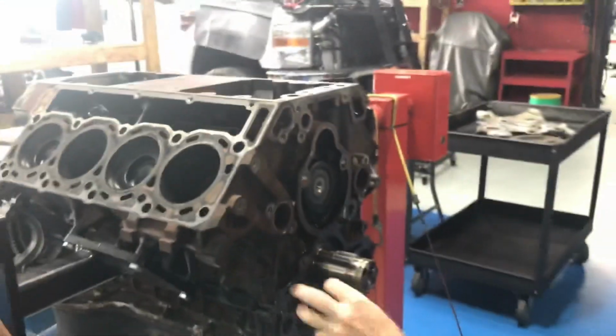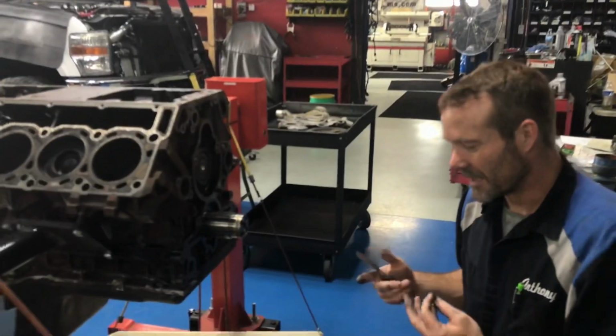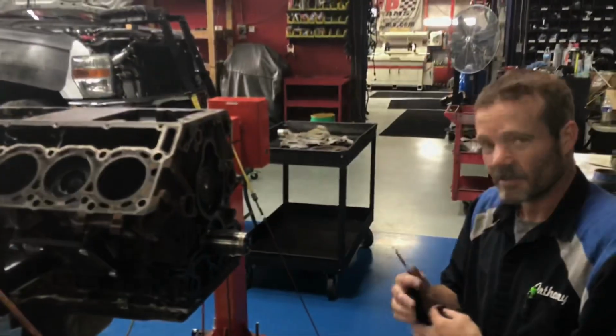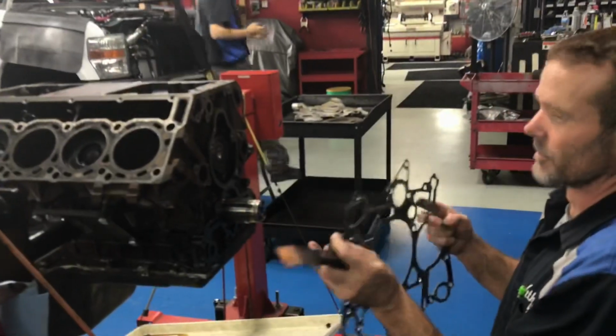I thought I would show that, because you grab that front cover and rip it off, you pull those out. Now you're going to expose the crankshaft. And if you want to do it like you actually have a head on your shoulders, you're going to take all the rods off so that that crank should spin free. And everybody says, I ain't never tightened the crank up, didn't spin free. Yeah, you're full of it, because I know you're lying.